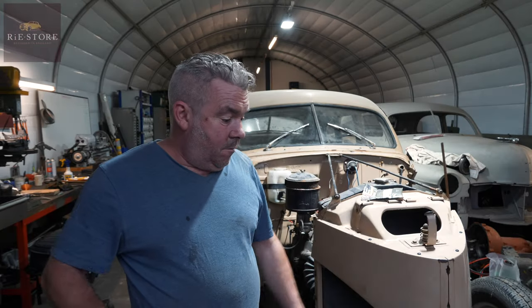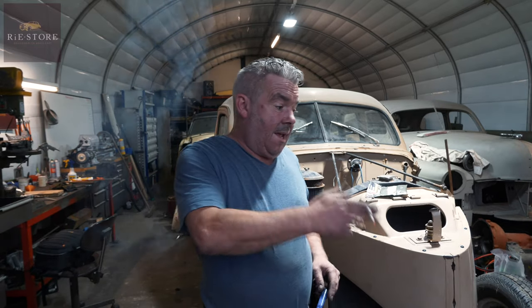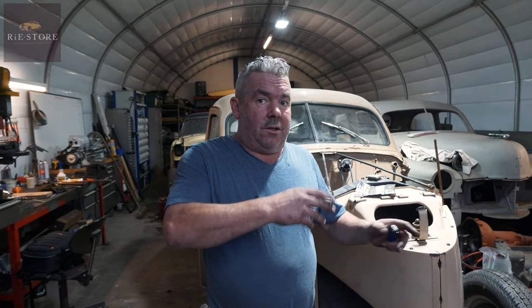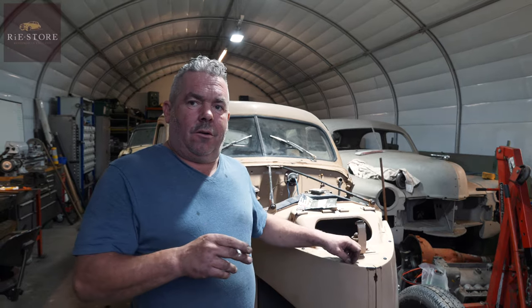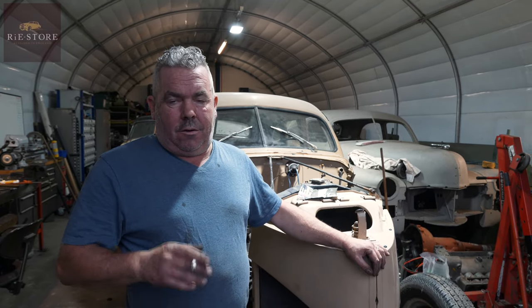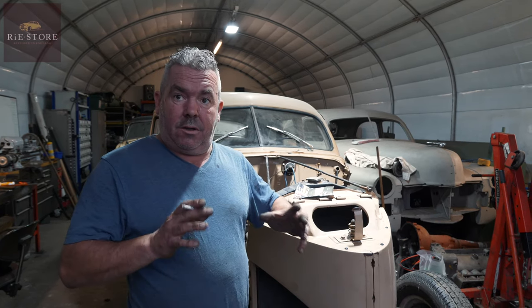Next week on the workshop. This one's obviously been a bit quirky. It's just the way it is. Which is why, again, people get in a muddle with them. Can you imagine doing that and then forgetting to do the timing? It's very easy to lose your way with it. I'm thinking people will look at it and go, well, I've done the timing, I don't need to go back through that. Yeah, if you adjust the points, your timing's gone. You mess around with a hand lever, your timing's gone. You've got to keep going back, just checking that everything's correct.